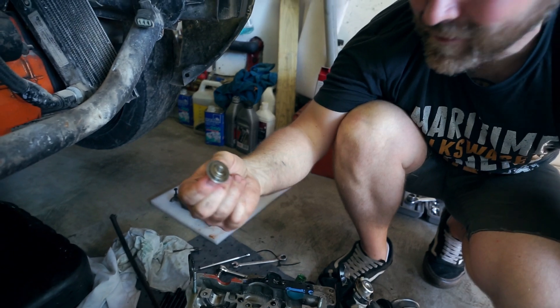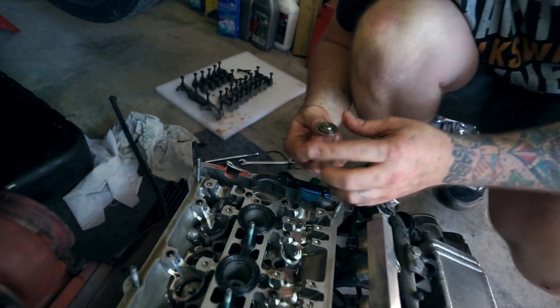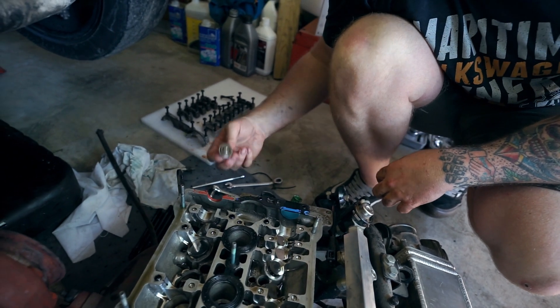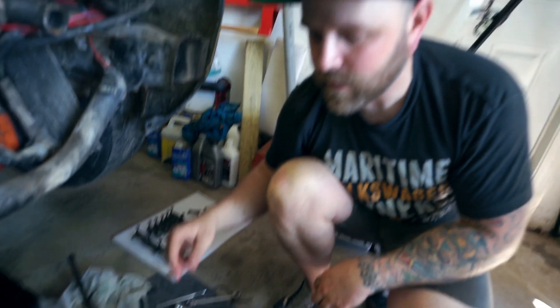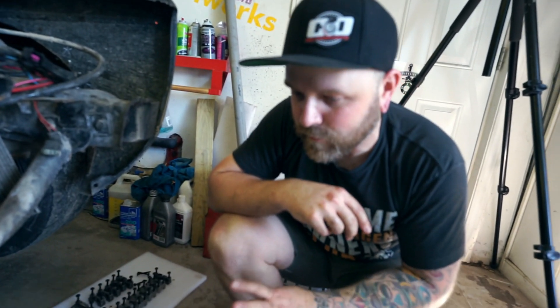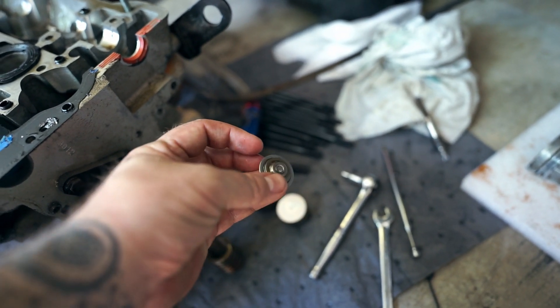She's broke. That would do it. Keepers are still in place. Maybe an over-rev, or something hit and broke that valve right off. Hopefully the guides are fine and we can just put some new valves in. Broke the tip right off.